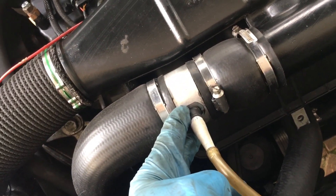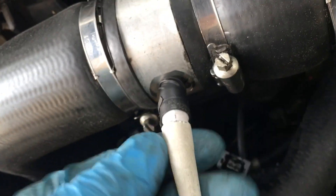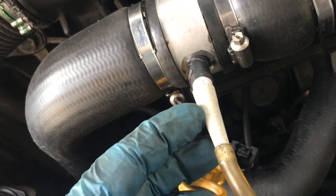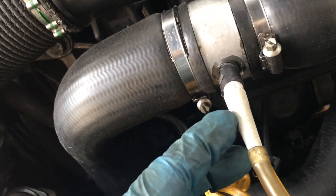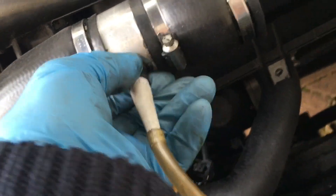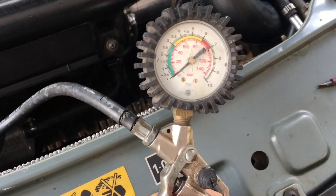I've rotated this piece of pipe, disconnected the air temperature sensor for the intake, and made up a little adapter out of plastic. These bits of plastic are actually the nozzle ends of silicone sealant guns — a couple joined together, another bit of plastic, a bit of tape — screwed into that bit of pipe and onto my tire pressure gauge.